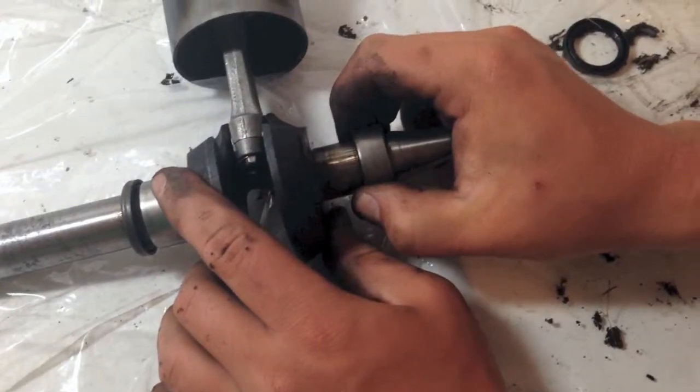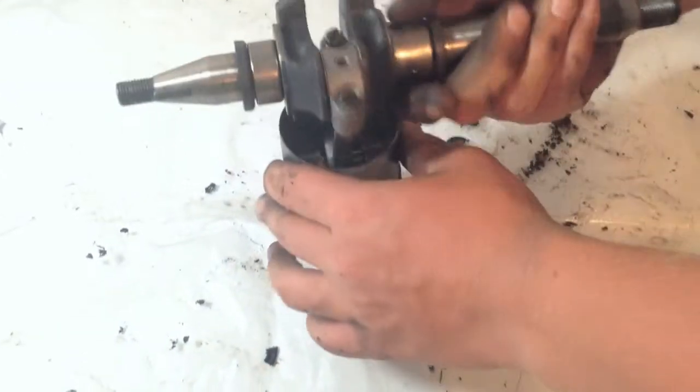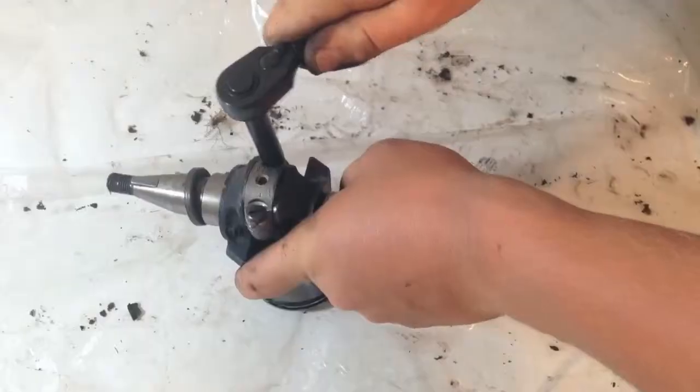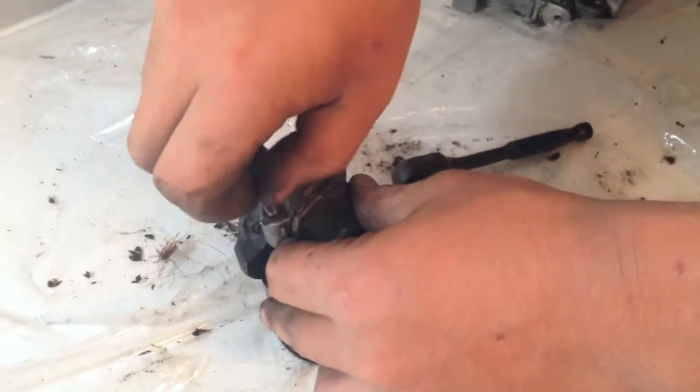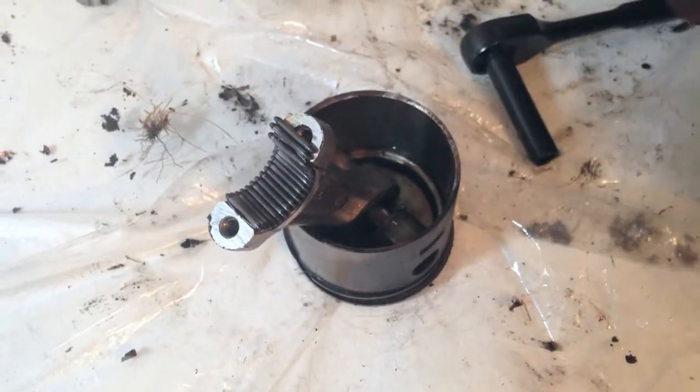To change the bearings, you can simply pull them off the shaft and slide a replacement on. To access the connecting rod bearing, you must first remove the locks on the bolts. This can be done by prying them down with a hammer and screwdriver. With this off, you can check the needles in the bearing to ensure they are in good shape or replace them.